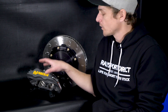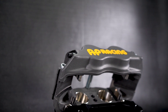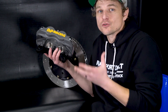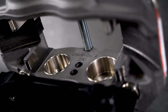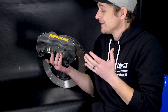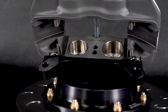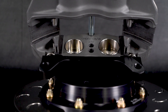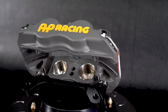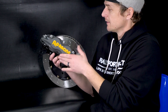The caliper is where all the magic happens. These are AP Racing's four-piston calipers, and somehow they've managed to get these down to 5.6 pounds with the bracket installed — that's crazy light. Inside, where all the stopping power comes from, are some impressively large stainless steel pistons. You'll notice there's no dust boots in there, which means these things are serious — track-ready serious. When it comes time to swap pads, they make that super easy with a single retention pin holding the brake pads in, so pad changes are quick and easy. Everything is just well thought out, even down to the heat treatment on the crossover pipe on the bottom side of the caliper.